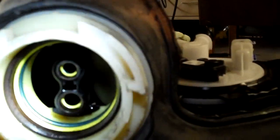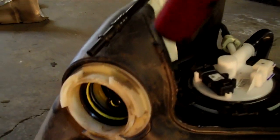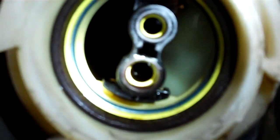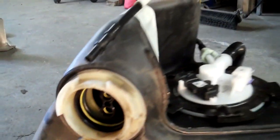When you go to pull off the pipe, oftentimes the O-rings are dry and they'll pull out of the socket and actually protrude out. To get them off, you just take a screwdriver and pry them off. You can see there's a solid block of plastic that they're in, and you just put a screwdriver in the middle and work it loose. Kind of a snap ring or something.